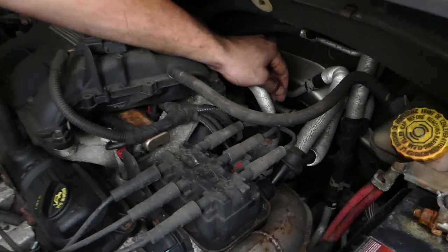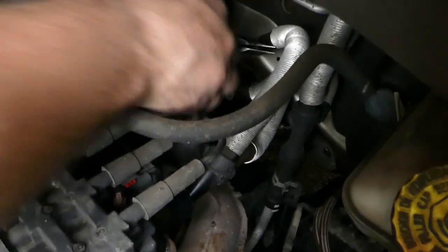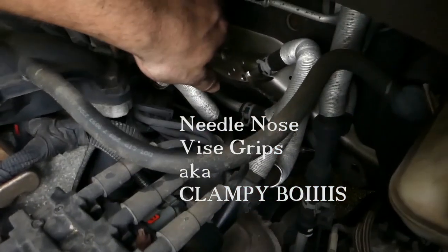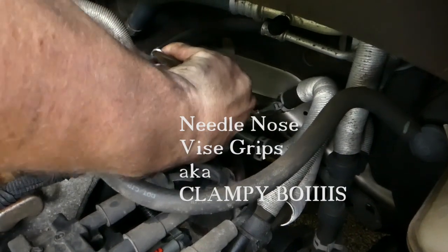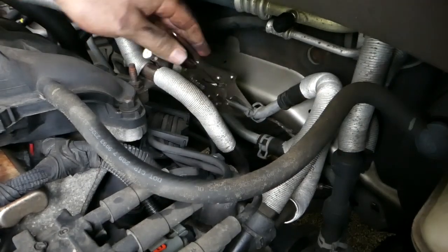The first thing that needs to happen when removing these is you need to remove your three hose clamps — you'll have plenty of access to get at them with needle nose pliers. I'm going to pull them forward instead of backwards, using tools that will lock on. These are my locking needle nose pliers, and once they are locked on they won't unlock and I can easily manipulate the hose clamp off.